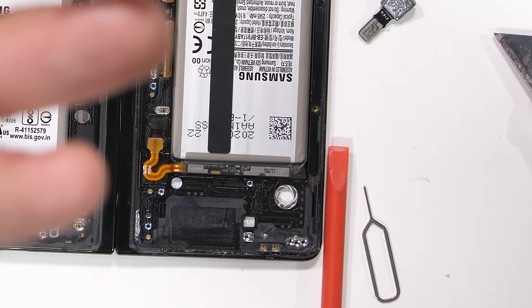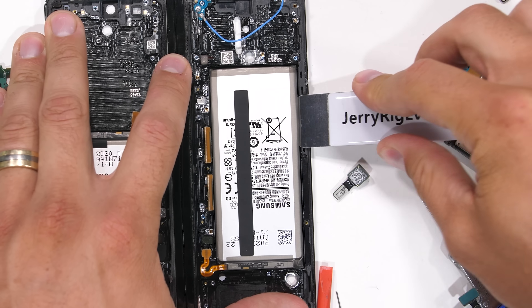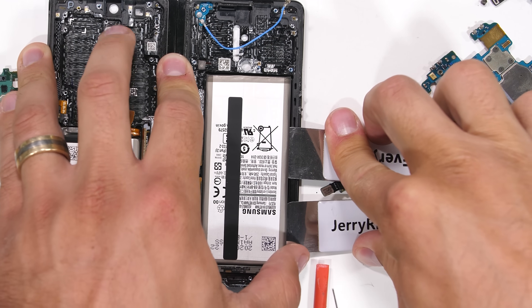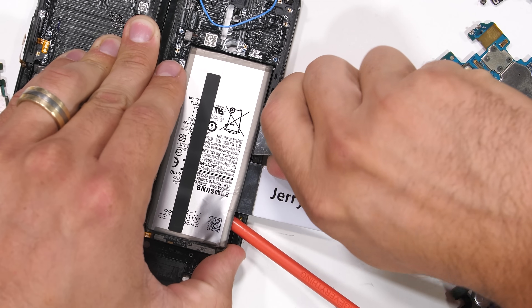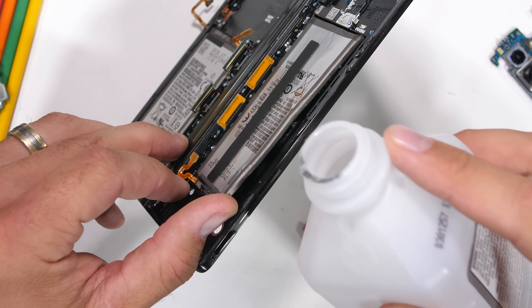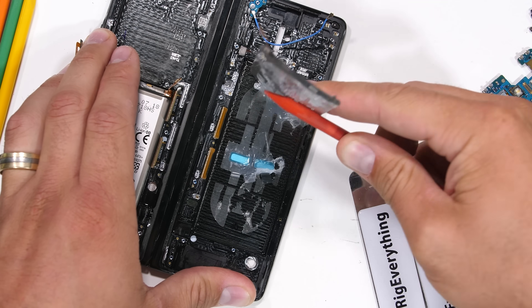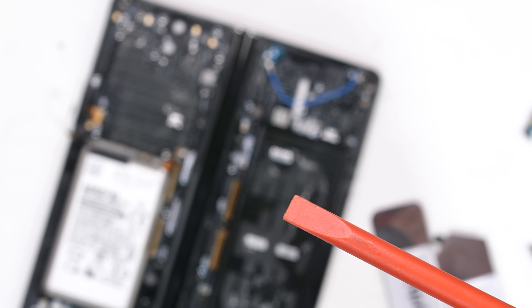The SIM card tray has its own cute little board — an SD card would have been cool too, but it is what it is. Now the part I hate most about Samsung phones: the batteries. While every other phone manufacturer is using normal adhesive or pull tabs, Samsung likes to show off the world's strongest glue. One piece of this stuff would have kept the Titanic from sinking. The phone's already sealed shut, and the most velocity it'll ever encounter is falling on someone's face after an hour of sleep scrolling — the glue is definitely overkill. I'll add some isopropyl alcohol underneath the battery to dissolve the adhesive. The larger battery is 2,345 milliamp hours and the smaller battery is 2,155 milliamp hours.